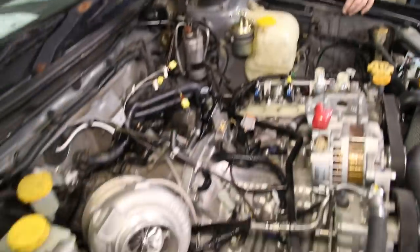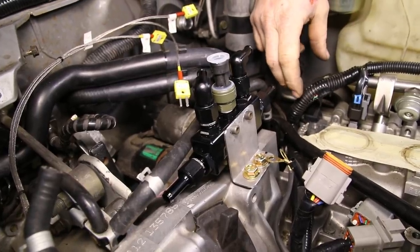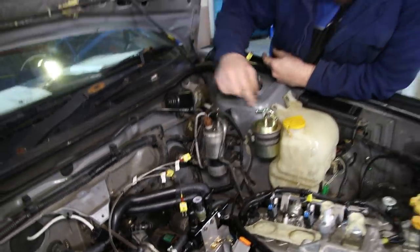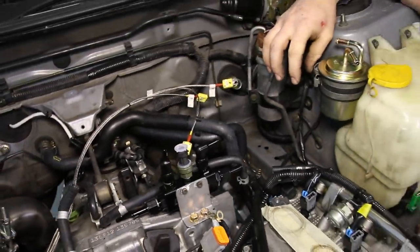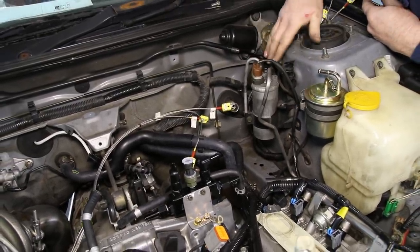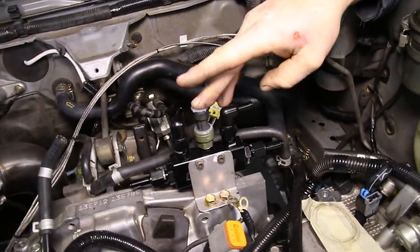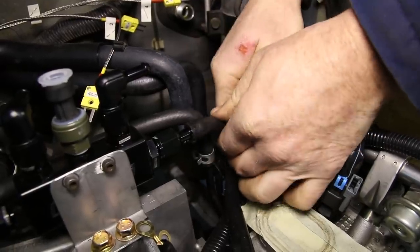Yesterday we did all our piping and everything - it's all finished, ready to go. We've had to remove it all again because we've got to do our fuel distribution and regulator. We're using this fuel distribution block - it's got two fuel rails because it's a flat engine. They're non-return. Fuel goes in through the filter, out through here, into the block, then onto the two rails. Then we've got our return - it comes back and goes into our regulator, and the regulator will return back to the original return line. So it's a partial returnless system but not a full returnless system. That's our fuel pressure sensor for the Haltech. We're using all-new 8mm fuel lines which fit the factory inlets and outlets on our distribution block. A new filter means the engine will only munch the cleanest of fuels.